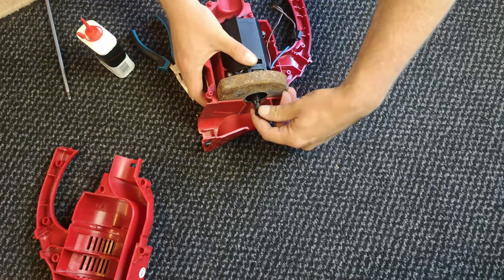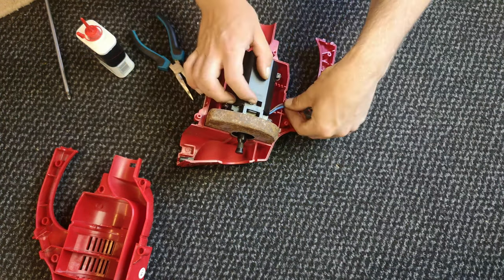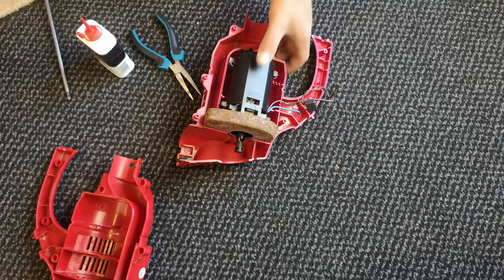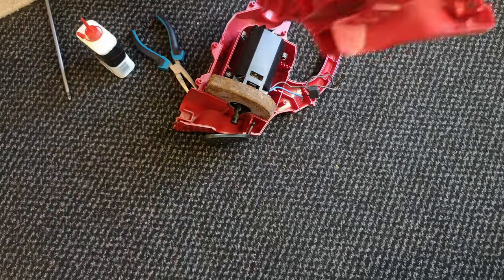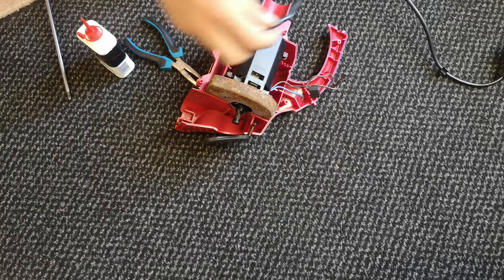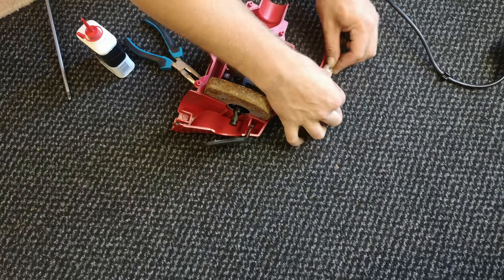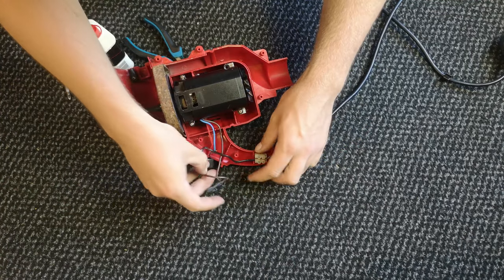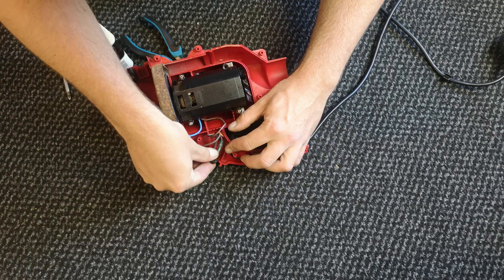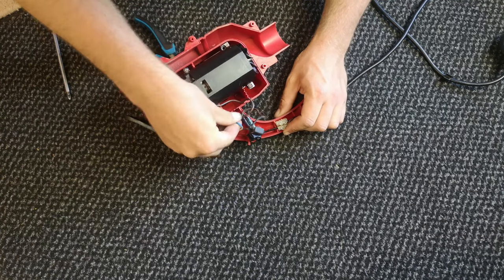Pop the saucer back on there and slide it in. Check that nothing's rubbing - this is what makes a slightly weird noise on my Broomie. This will flex a bit and the fan touches the metalwork, which is a little bit annoying. We'll do that now. The flex needs to go on, which shouldn't be too difficult - it goes in there, comes through there. You can sort of line up the old grooves. The chocolate block sits there. The switch goes there - very nice.